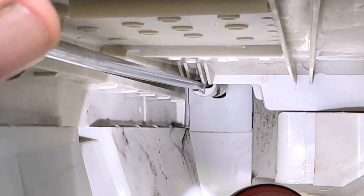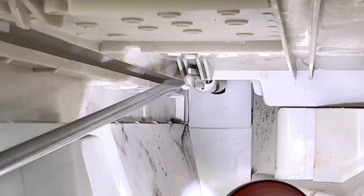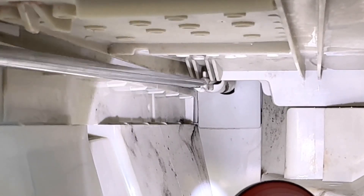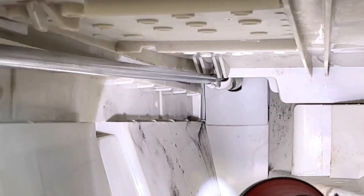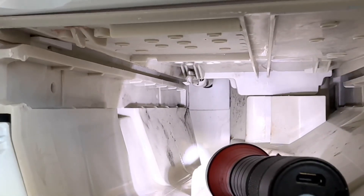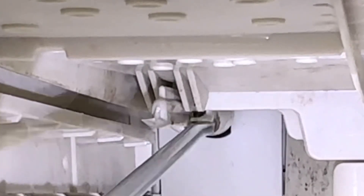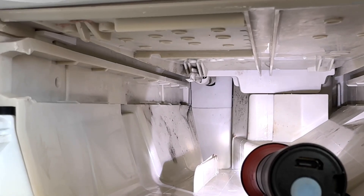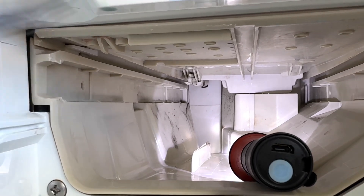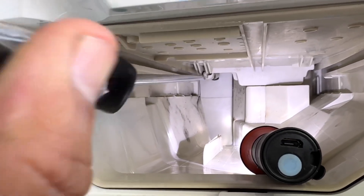You want to push it all the way to the back — see, it's working. What you can do is play around with it, get a flat screwdriver and push it, and see if it's coming out fully. Once in a while there's a tiny spring at the back right there. That spring can get rusty, or you can get calcium buildup there, and that will not let this lever push in and out smoothly.